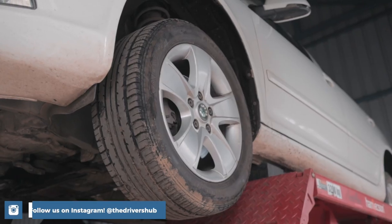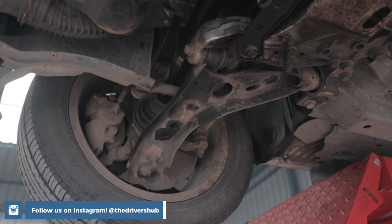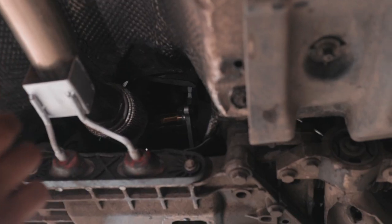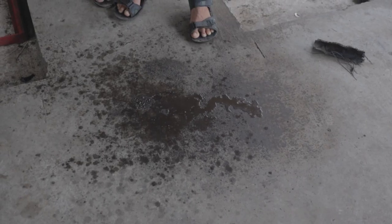After I got done fitting the Audi R8 ignition coils to the car, we raised the lift up to address the oil leakage. After a thorough inspection, we found out that a screw in the oil hose assembly for the turbo was creating the leak. So we quickly took a rubber O-ring and covered the leak up, but this was a very temporary fix.